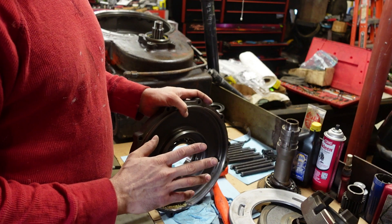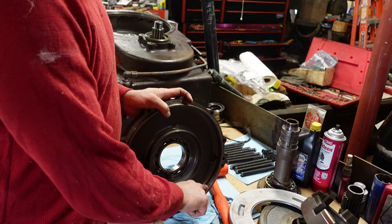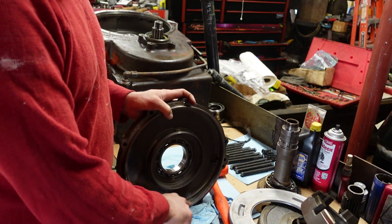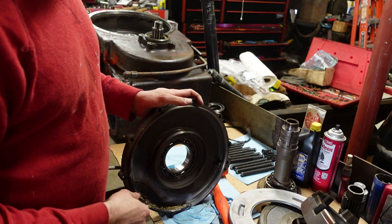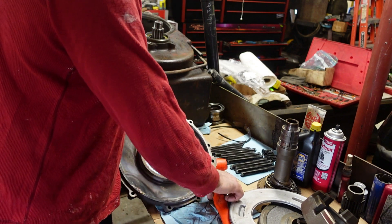I'm going to take some time to really indicate it in well in the four-jaw, because I don't want to take any metal off this cast iron. I just want to take braze off until it's all smooth, and then we can give it a quick polish in the lathe, put it back in the surface, and keep stacking this together.